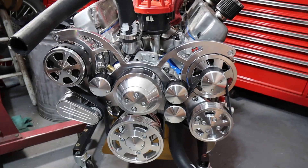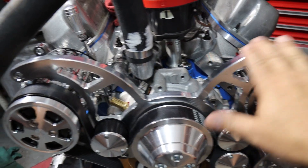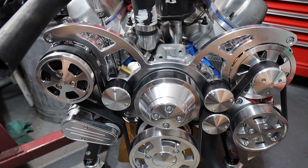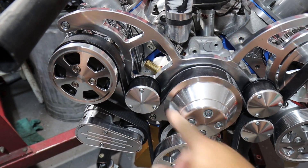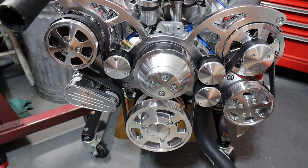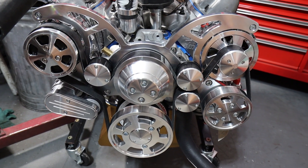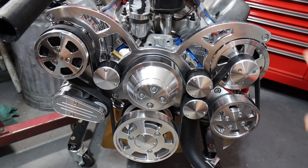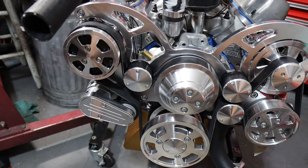The kit is very tightly packaged and entirely supported by one bracket. These two horns that go across the front are mounted to the front of the engine with four fasteners — one down here right below this idler pulley, one behind it, and one behind each of these — and those bolts go through the water pump, then through the timing cover, and directly into the engine block, supporting that large plate. The three accessories — alternator, power steering pump, and AC compressor — are all mounted to this single bracket, along with three idler pulleys and a single tensioner pulley.